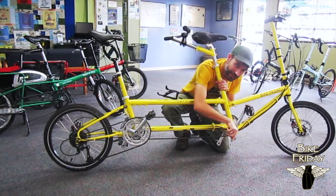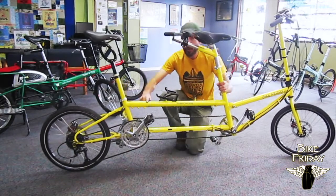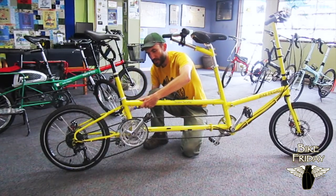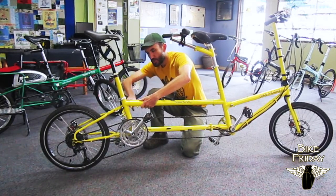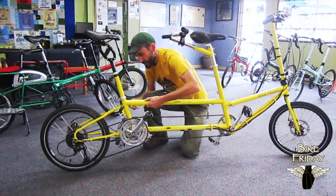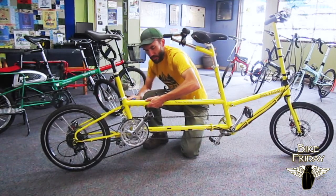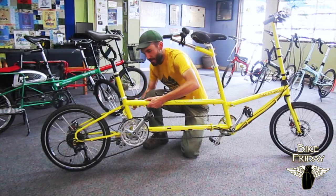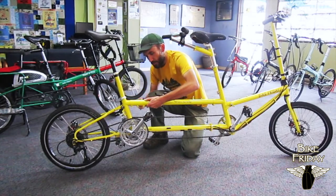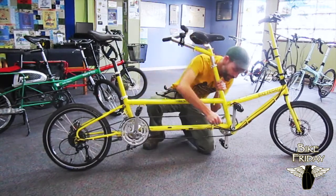In that case, I will tighten at least one of those bolts back down to prevent it from slipping. Then I'll move up to the top tube — there are three bolts on an oversleeve here. I'll loosen two or three of those until I feel the tube relieve some stress. I'm lifting up a little bit too to help it relieve some stress. Once I feel that move a little bit and the stress is out of the frame, I tighten all three bolts back down, and I'm ready to repeat the previous step with the loose bolt down here.